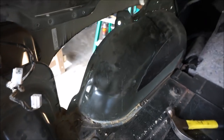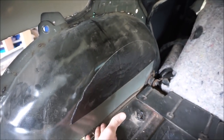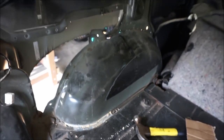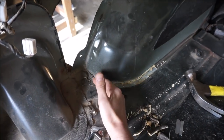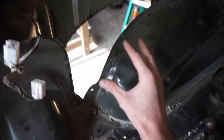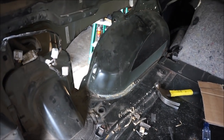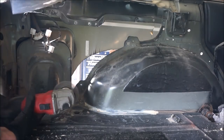So anyway, I'm going to go ahead and get this measured out. I've got to try to get as straight a line as possible, get all the rest of the seam sealer taken out, and then I am going to cut the floor right here, try to get everything matched up even with the outside of the fender, and move this back and get this project going. What a pain in the...